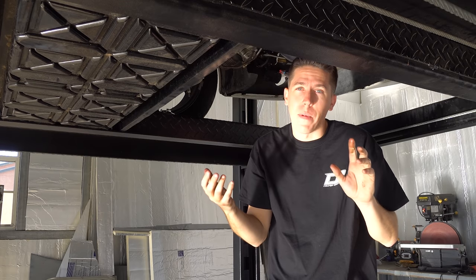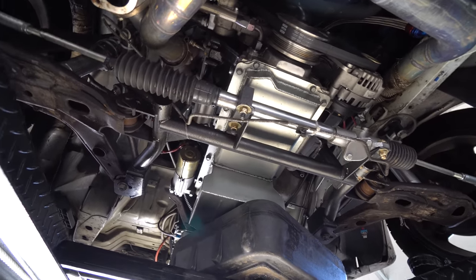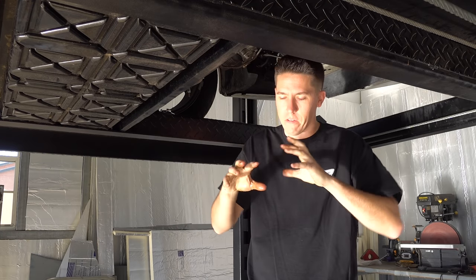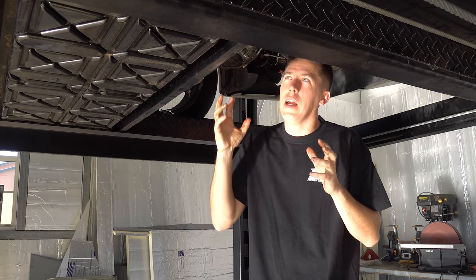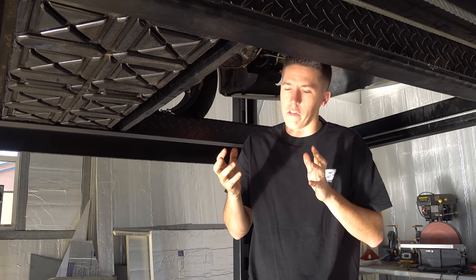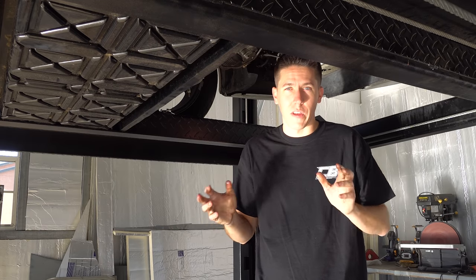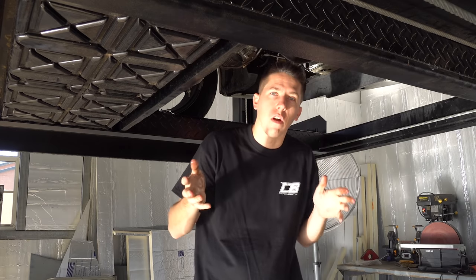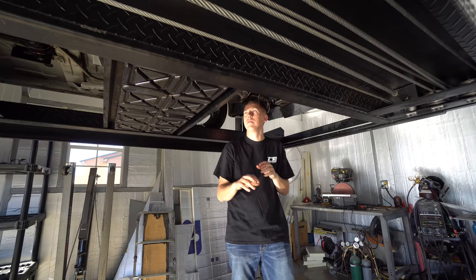The second thing I hate about my turbo Camaro is that while we're under the car draining the oil, I have no engine diaper on it. There are multiple safety concerns — everything is pretty much to SFI spec, but it does need an engine diaper. Also, the oil pressure sensor on this car is a factory one. I had the car on the dyno and it lost it and started puking oil — if that happened on the track it could have been devastating.